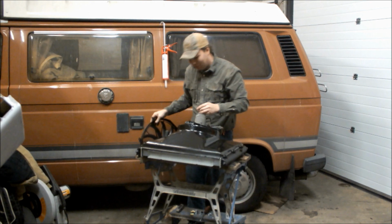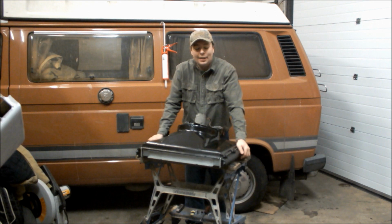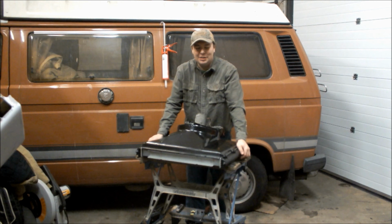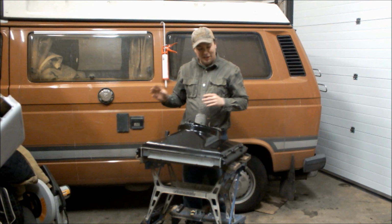80 watts, 12 volts. So the thermostat that turns the fan on is actually bolted into the front of the radiator. I'm going to use the original one off of the fan. It's got two temperature settings. I think one comes in at about 70 degrees, one comes in about 85. You can look at them, they're all about the same. So what I'm going to do, the lower one, I'm going to switch this fan, and as soon as it switches to the higher one, if it starts getting warm, it'll turn them both on. So that's really easy. I'll do a quick video on that when I get around to doing it.